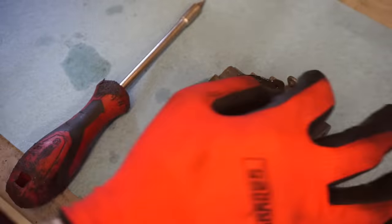All right, we got the carburetor back together. Thing is absolutely spotless on the inside. I cleaned it out with brake cleaner. Plus, we blew it out with the air compressor. Everything is back to the settings it was supposed to be at. All the passageways are cleared. I don't know, the diaphragms look pretty good, but maybe they're not doing their job. We'll reinstall it and see if she fires up here.